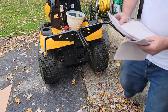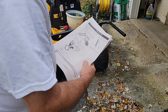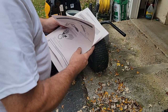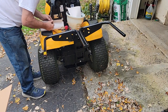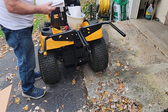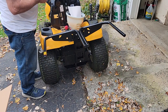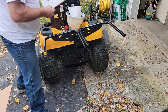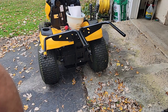There are a couple of supplemental pages — one is putting the end caps in, which we did, and one is to twist your hose into that bracket and install the ring onto the free end of the hose. So we've got to look at that yet. Then there's accessories — we don't care about that. Back to our page: assemble the remaining bagger components. With the mounting brackets assembled and in place on the tractor, snap the upper chute support in place by first clipping the side portion.